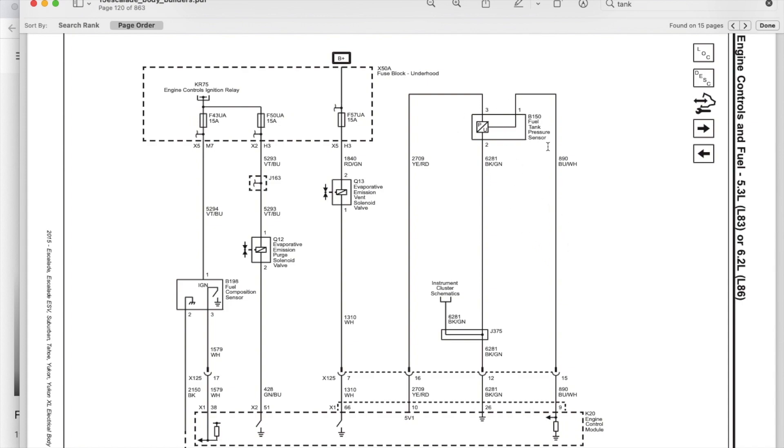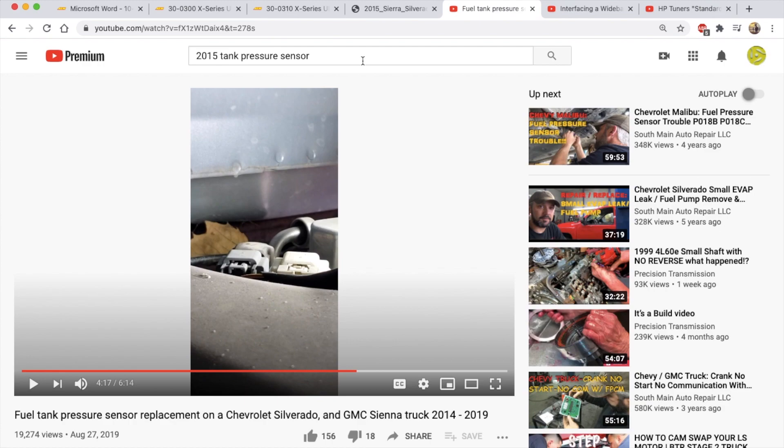We're just getting rid of this sensor and injecting our data here. I'll put a video at the end showing how I connected the wires — that's one way. Or you can go to the front of the vehicle, go into the physical connector on the PCM itself, get a couple of pin pigtails, remove the one on pin 9, fold it back and tape it off, then repin it with a pigtail so you have a wire running back to the white wire on the analog gauge. As far as the physical install, it's one maybe two wires.